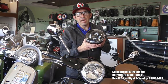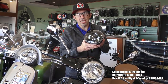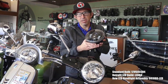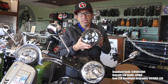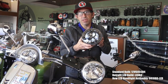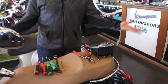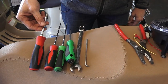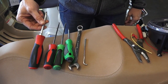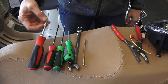For the new LED kit, the part number is 641080-LED — a standard OEM part number with the suffix of LED. It's a very simple install, only a couple steps more than just replacing the bulb. On any of the modern Vespas, 2010 and on, many of the screws are Torx, so you're going to need a T25 Torx driver, which is a star-shaped driver.